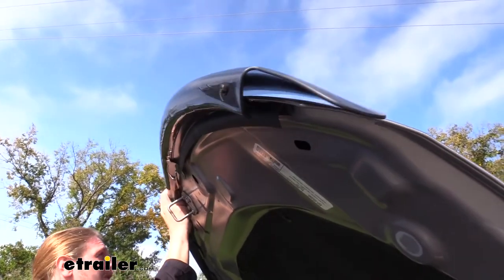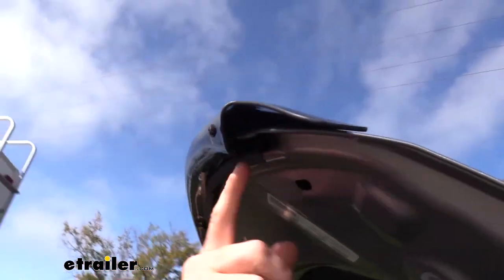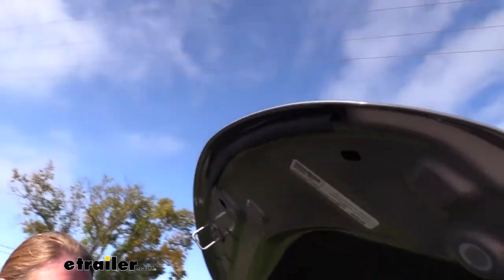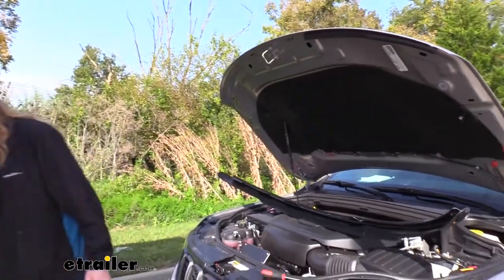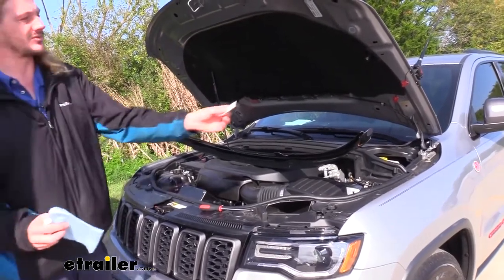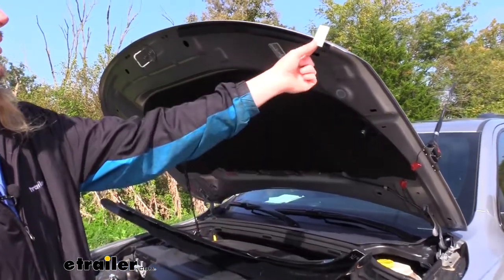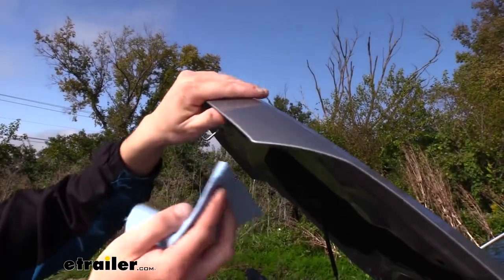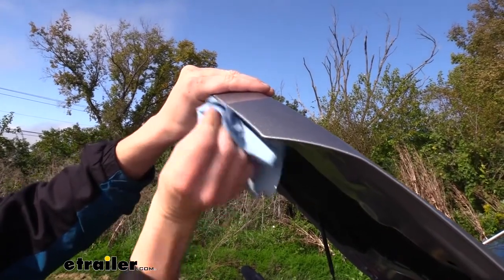It's important that we know the exact location where this is going to slide on — right here at the seam about where it gets a little bit thinner. That's where our bracket's going to slide over the hood, but we don't want to slide it over as it is right now because that'll cause scratches to our paint finish. There's a protective film that comes in our kit. We wanted to hold it up there first to make sure we get the placement right the first time. Now we're just going to use a little bit of alcohol to clean off the surface to ensure that our protective film has good adhesion.